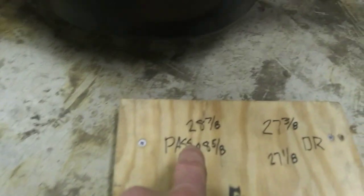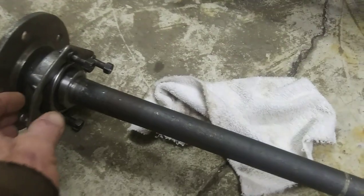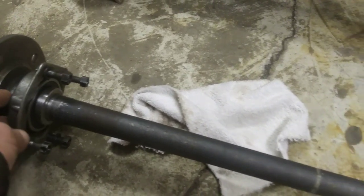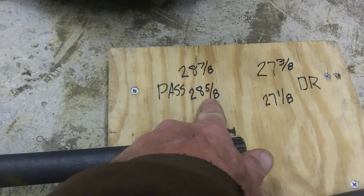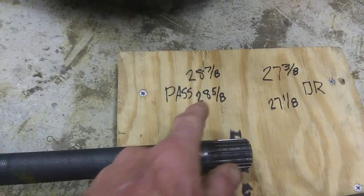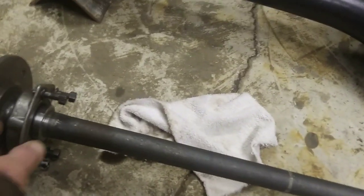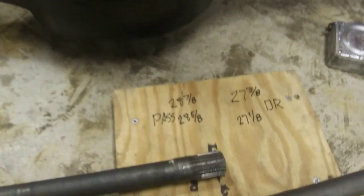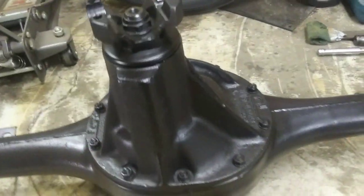On the passenger side I did the same thing with the stake — put it in there and got 28 and 7/8 inches. I measured the passenger side axle from the bearing retainer to the end and got 28 and 5/8, so that's a quarter inch shorter — perfect, a quarter inch from bottoming out. Maybe 3/16 each way since it's kind of hard to be exact, but yeah they would have bottomed out. Rear end is all together now — spins nice and easy, painted up to match.